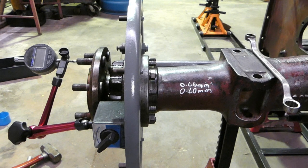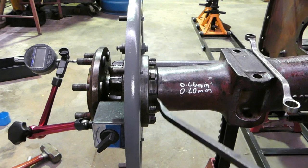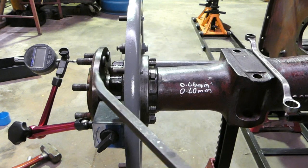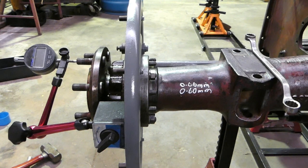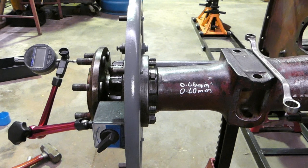So there's a seal in the centre housing here. There's an outer dirt seal on your axle and there's an inner one. Now, for doing the axle setup, I leave this one out. If you have to take the axle on and off a couple of times, there's no real sense in having to drag the axle across the seal, or you have a chance of damaging the seal. So we've left the seals out. Each side has to come back on and off a couple of times normally.